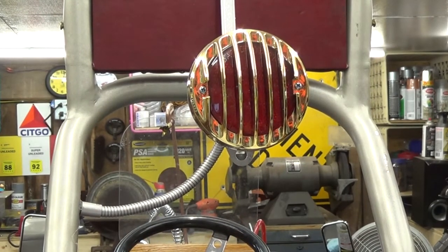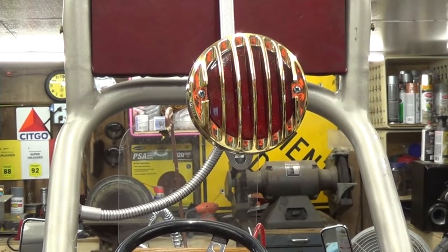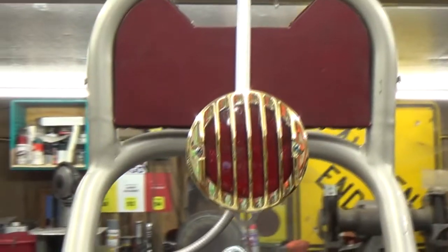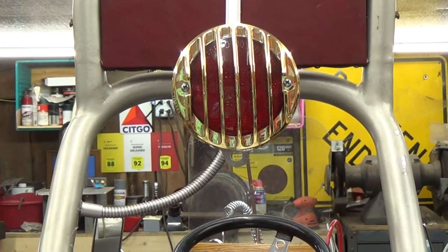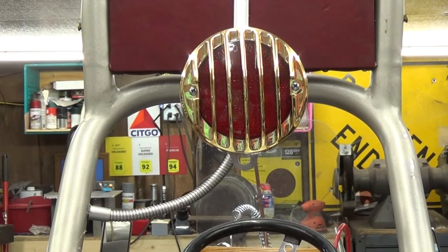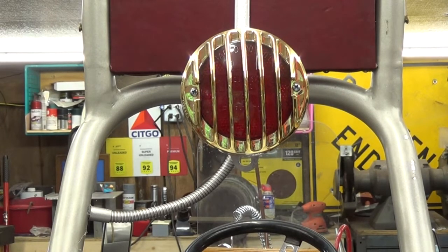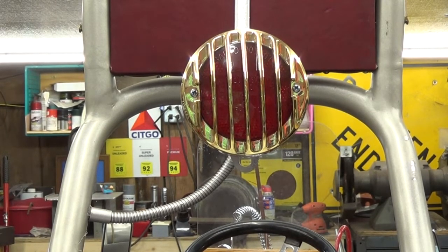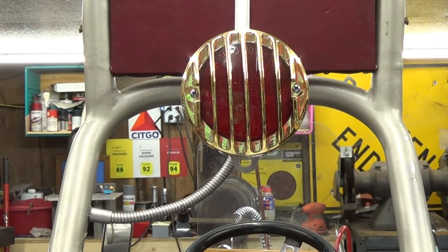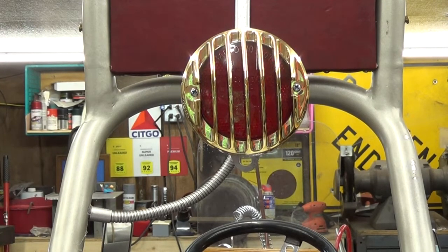So, yeah, I'm glad that the carburetor came in. I have a problem with it picking up the prime, and it might be because of that vacuum leak. And that could be the problem all along with the original carburetor, with that fuel mixture adjustment screw missing out of it. That was sucking a lot of air in there, which would have made it hard for it to suck in fuel. So yeah, a little more work to do, but we're working at it.